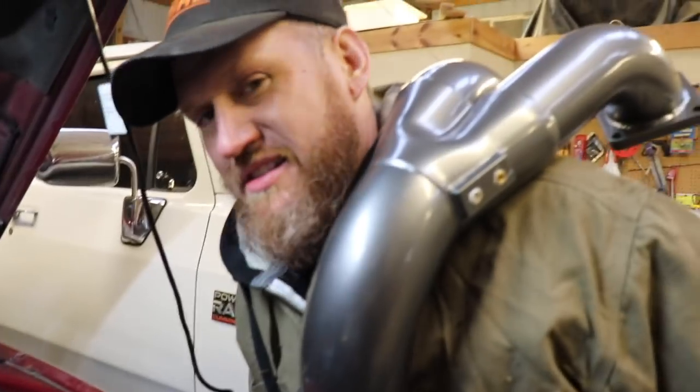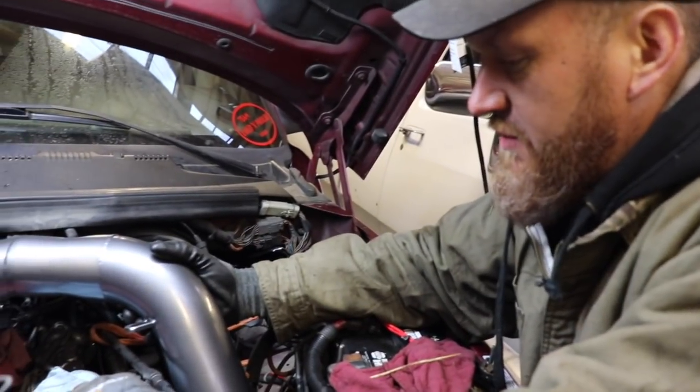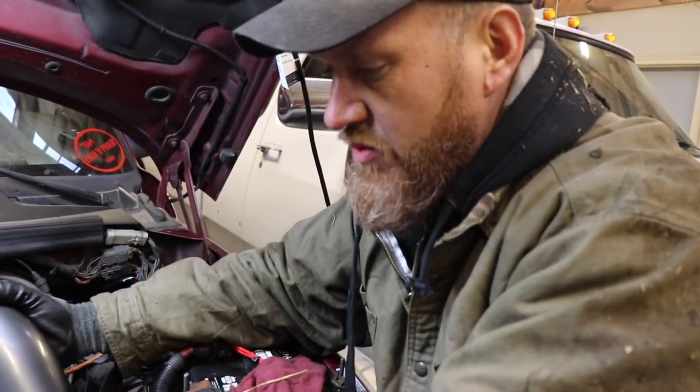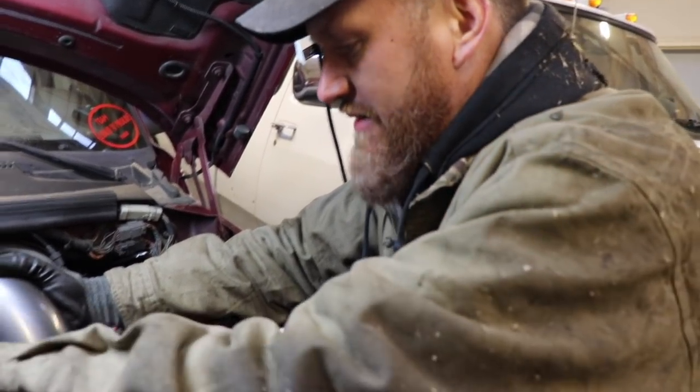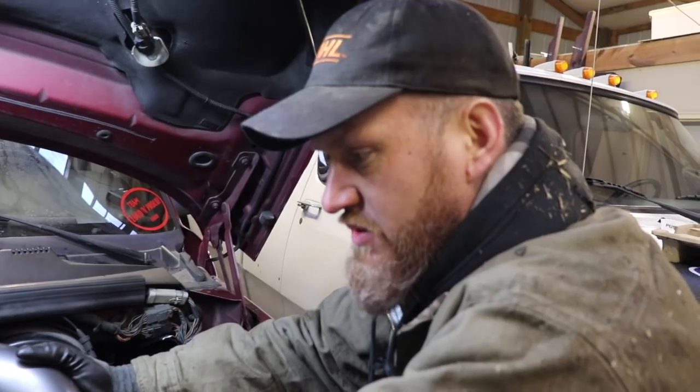They'll be the judge of that when they hear it through the video. They'll tell you what it actually is. And then the one other thing that we failed to realize is that we needed special sockets for these delivery valves. So we have that coming, we have the heater grid coming, and then we have some rocker arms coming for this to be able to accommodate it.